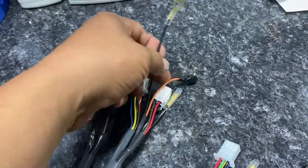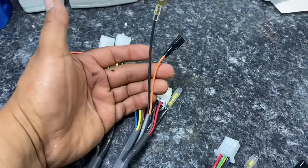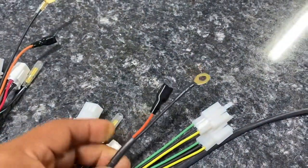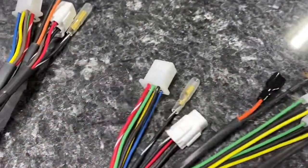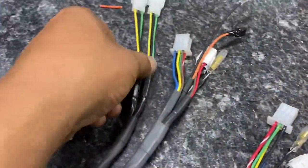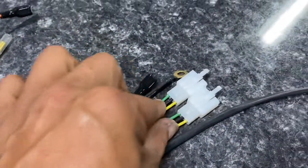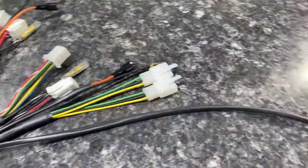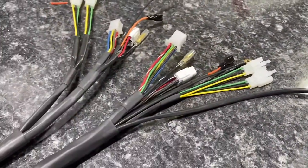The coil wire right here, I did that just like factory where it could be tightened way up. It looks a lot cleaner. You got your factory light switch, headlights — I didn't bring them out so far apart. They're just really tight right there because the headlight connectors are right next to each other, so that comes out pretty good. And then the indicator lights. This one looks so much cleaner already, and it's only the second harness.